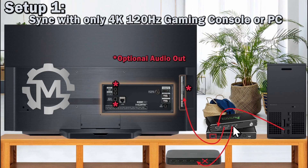You want to avoid the eARC or ARC channel if you're using a soundbar or receiver. The second output of the AVStar HDMI switch is set to 1080p — that's 1080p 120Hz. The Hue has no problem with that signal. That goes into any available HDMI port on the Hue and the HDMI output of the Hue is unused. You can also drive a soundbar or receiver with the optical out or analog output. Make sure your console is set to 4K 120Hz. Note that some TVs are only HDMI 2.1 compliant for 4K 120Hz on a specific port — for example, LG OLEDs may require Instant Game Response to be enabled, so consult your manual.